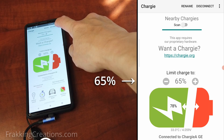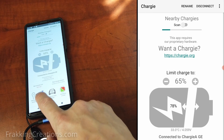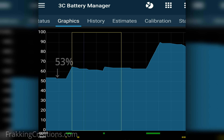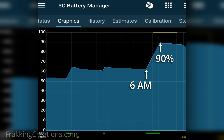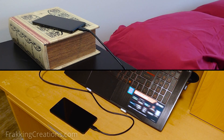You normally set your charge limit on Chargy to 65% with an allowed charge drop of 3%. You now set the top-up percentage to 90% and a start time of 6am. Let's say your smartphone is at 53% when you plug it in at night to go to sleep. Throughout the night, Chargy will charge your smartphone up to 65% and let the charge drop to 61% before it starts charging again up to 65%. The cycle repeats throughout the night, protecting your battery by keeping it between 61% and 65%. At 6am, Chargy will start to charge your smartphone up to 90% so that when you are heading out the door to go to work, you have 90% state of charge to use for the day. No more keeping your battery at full charge all night long or all day long at work, while still having decent runtime capacity for when you need it.